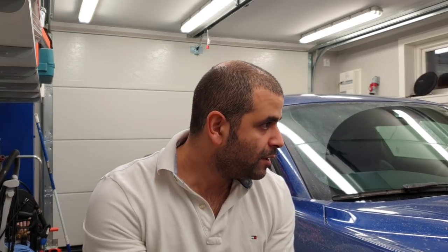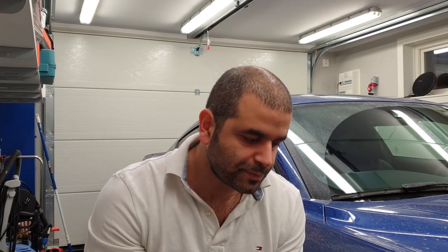if you have mechanically washed the car, so to speak, not just rinsing it off, depending on how dirty it is, of course, and if you have some type of paint protection, by using the leaf blower, it's difficult to say, but 90-95% of the water on the larger panels you can remove without actually touching the car. Then you will have water in the nooks and crannies which will splash up, etc. So it is difficult to hunt all of those water beads with the leaf blower. Then you might need to use a drying towel.